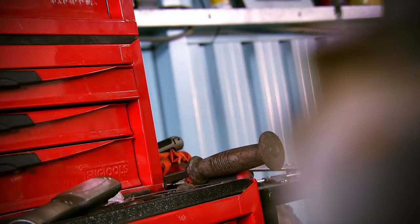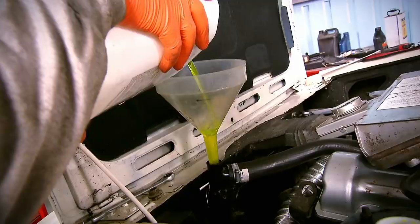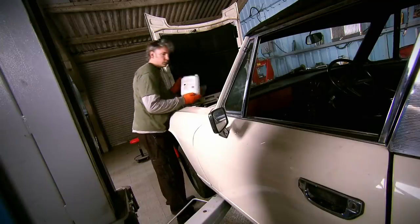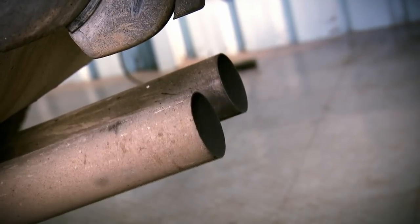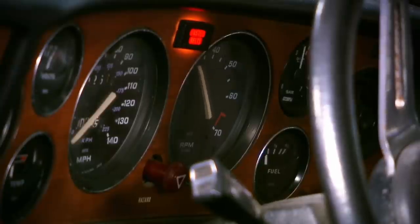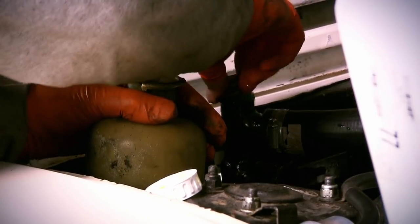And while you reflect on other momentous motoring moments, I'll just top up the system with coolant — this is tap water mixed with 50% antifreeze, which you should change annually. Now let's get that coolant circulating so I can bleed any air out of the system. The engine needs to be at working temperature with the thermostat fully open, and any air bubbles will be forced around the system and then vented naturally out through the open bleed screw.